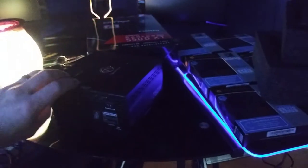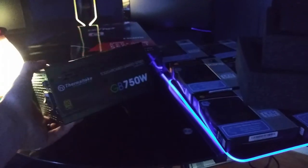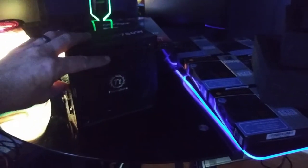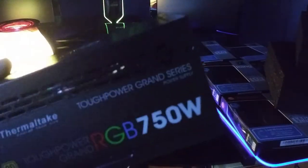For your i7, your 1080s, your 2080 Ti's, and all your RAM — you have to have a good power supply to make sure all those components are getting electricity efficiently and continuously. You don't want anything to catch fire, and you want it to last a long time. My advice: definitely buy a nice high-end power supply. It has to have an 80 plus rating — bronze, gold, silver, platinum, whatever. And just because it says 750 watts doesn't mean the computer will pull that — the computer only pulls what it needs. That's a very common misconception. Look at all the venting — plenty of airflow, this thing isn't going to overheat.